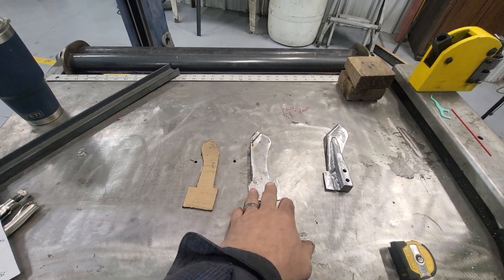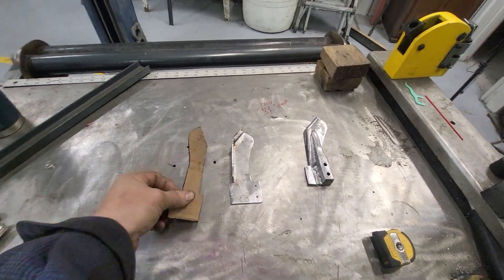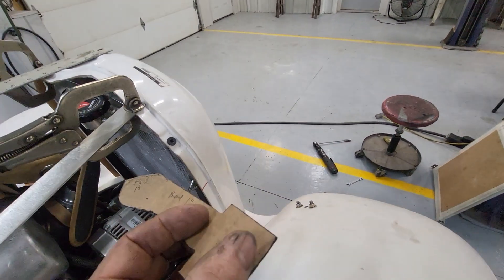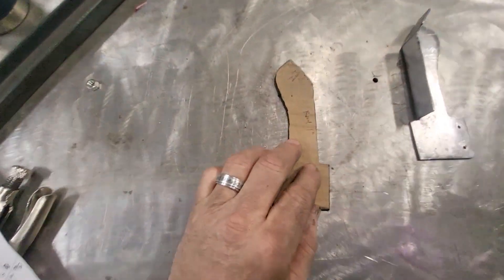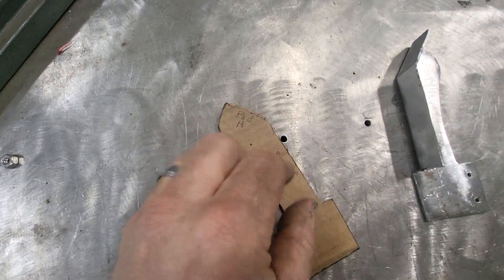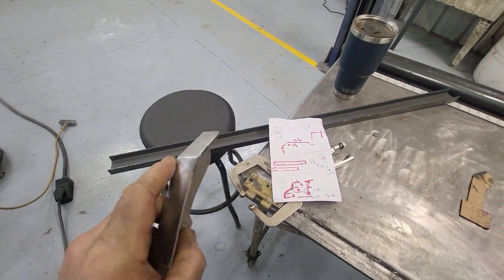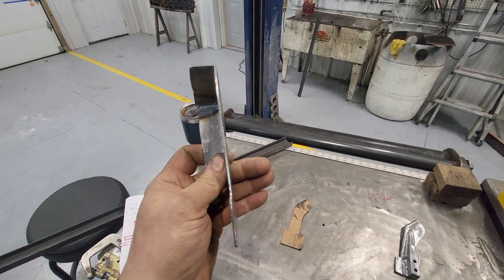To do that I have the evolution of humankind here — cardboard — which evolves to a basic shape in this case bent, and then to a final bracket. I made myself a cardboard profile where I wanted to grab the top, have some space, and then have a mounting flange for that piece of channel. I chose to make a pad up here — that's a bend — and I wanted to strengthen it so I put another bend in. This is the mirror image. Then I went and bent these over, welded them together, and ground it.